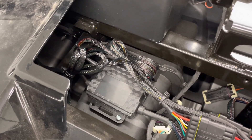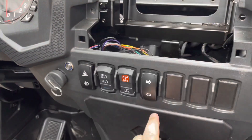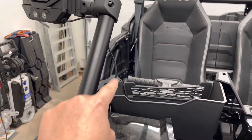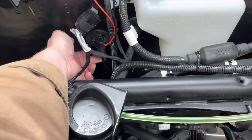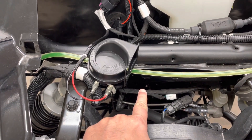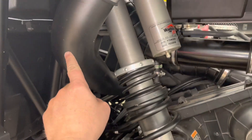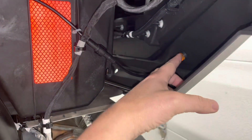On our RZR, we chose to install the main board right there on top of the glove box — we used two screws and also adhesive tape. It was very easy to pop out these pieces and install the switches where we wanted them. This is where we chose to put the horn, and here behind you can see how it's all hooked up. With this panel removed, it was easy to run the wires for the rear view mirrors and turn signals. These are the two wires that run back to the rear turn signals — we came through this same location in the firewall, then went down and through the tunnel under the floor.